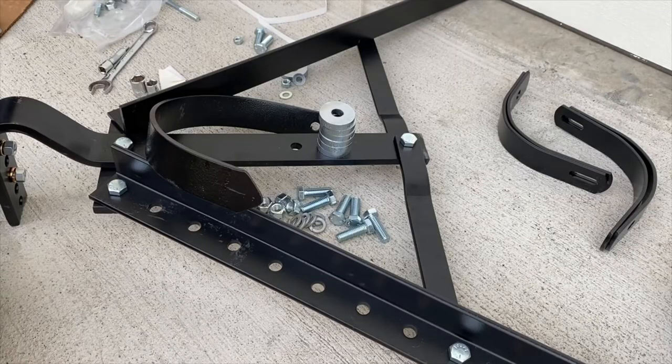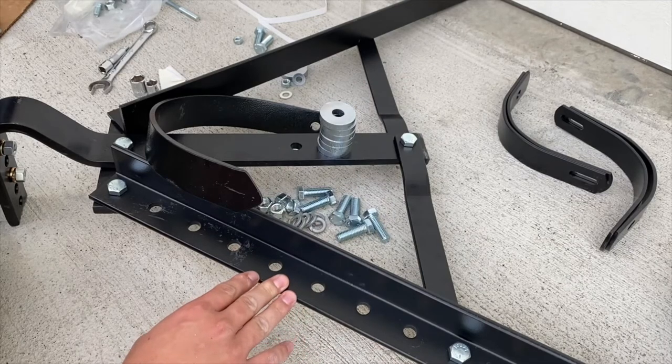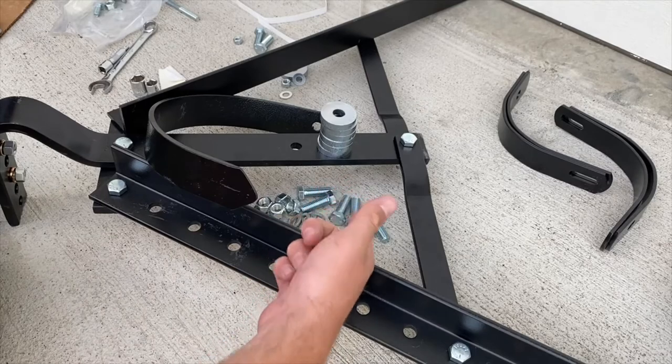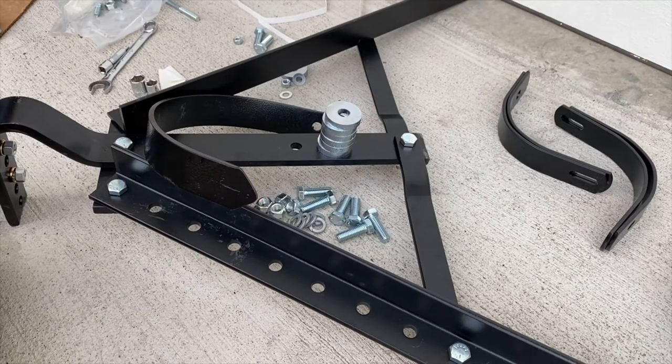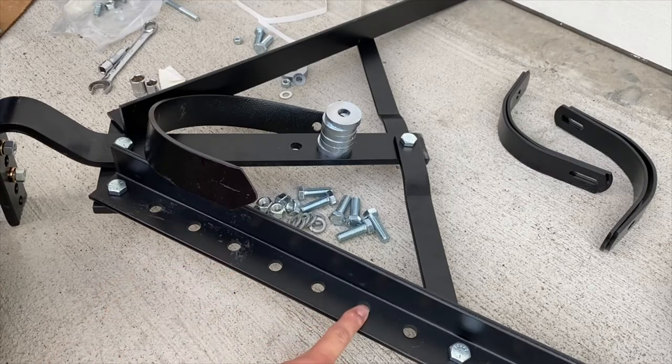Figure four is assembling the spring shank assembly - we have steps 4A and 4B. Step 4B covers putting the extra shank on the center bolt. I'm going to do just the outside ones for now. The hardware uses the same bolt setup plus these giant spacers. The instructions show placing one in the first hole and then every three holes after that.